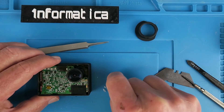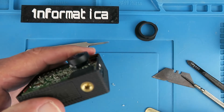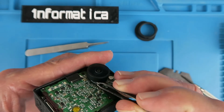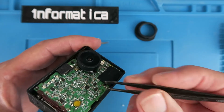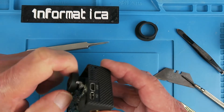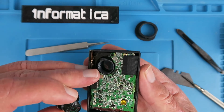On the edge of the lens there you can better see some of the hot melt or similar type glue. I'm going to scrape away at that and see if I can loosen the lens. I've managed to remove some of this glue — it's somewhere between an epoxy and hot melt glue. It did not want to come off. I had to put a new scalpel blade on my scalpel and have a good old dig at it. It's a very dodgy manoeuvre, being so close to these tiny components on the circuit board — one slip and you're done for. But at last, it can be unscrewed. We don't want to leave the sensor exposed for very long, for fear of getting dust on it.